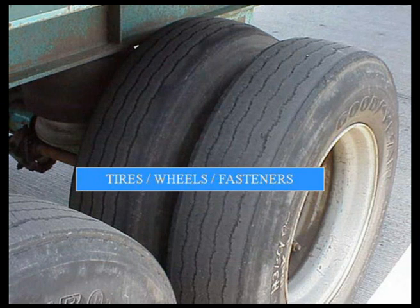There are going to be some changes in the tread depth law. They are increasing the minimum tread depth on the steer axle. Right now it's 4. It's going to go to 6 on the steer axle. And there is a possibility that your regular tires are going to go up to 4. We don't know yet. They may leave those at 2/32. They may go up to 4.